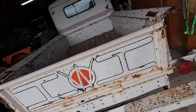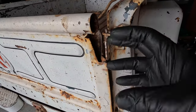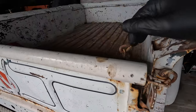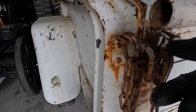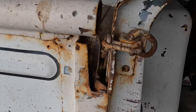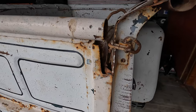Let's tackle this tailgate problem. If you remember from one of the previous videos, I pointed out that we no longer have a structural place to latch the tailgate on this side. Let me show you what the other side looks like. There's supposed to be this tab right here and it's supposed to fit inside the tailgate — that's how you keep it latched to prevent it from opening. But this side looks like it's been completely ripped out, probably rusted, got weak, and at some point just completely fell out.